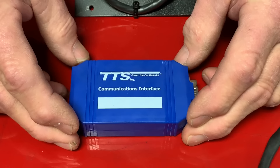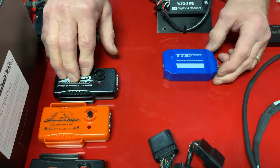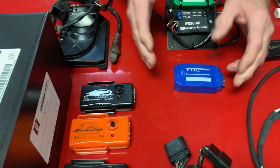The Harley-Davidson product is good for Harley-Davidson stuff. But if you go wild with a D&D exhaust, wide-open drag pipes, or a high-lift 600-lift cam, that's not in the wheelhouse of the Harley-Davidson tuner. Harley-Davidson products can tune their own parts very well, but go into the aftermarket and try to tune with it — not anymore. Harley-Davidson has made this tuner EPA-compliant, so you have to choose others. And the cost increases as you go with different tuners.